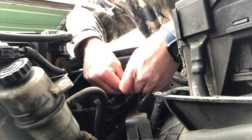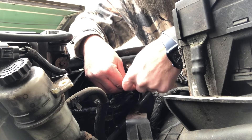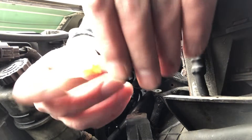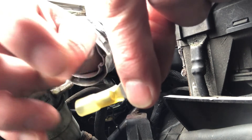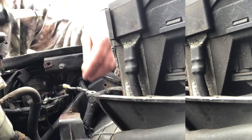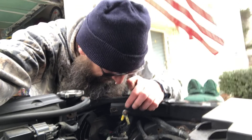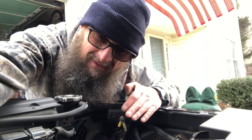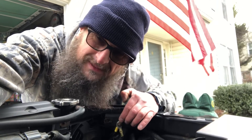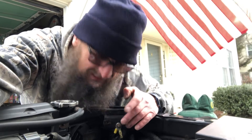I'm going to seal it with a sealed heat shrink type. Unfortunately, this is the only one I got, so it's not going to be the easiest. I've got to get the wires inside this piece, and when I heat shrink it, it will seal and solder to that. That's the best I'm going to do — I got a crimp on one of them. The solder didn't get that hot, I'm not going to lie. Hopefully it's good enough to get me some lights; when it gets warmer I'll have to do it again.